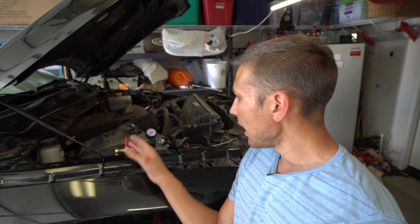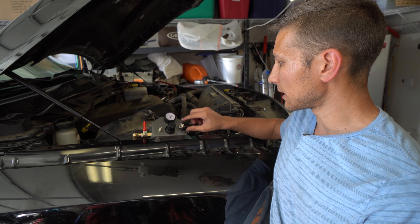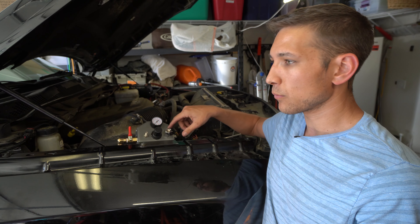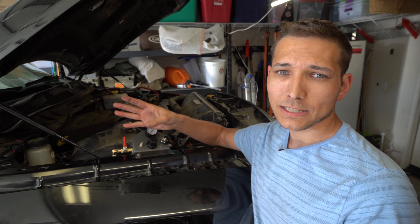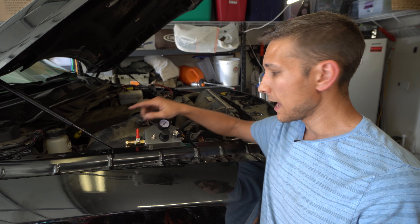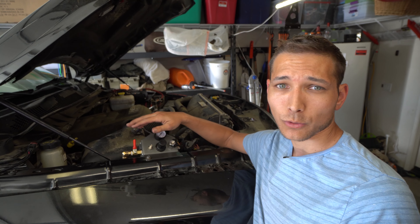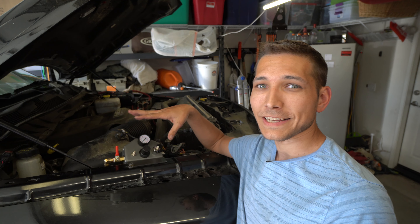I did reach out to UpDown Air to see what they have to say about that, because the kit should have come with the input on the side instead of a plug. Otherwise, installation has gone well. I did add a little on-off valve on the side, because the way the unit works is you have a little valve that you can flip open to air down your tires. But because I'm running an air tank, if I have air in the tank and I open this valve, it would drain air from the tank as well. So I threw the little valve on so I can keep my air tank fully filled up and close it off. When I air down, I'm not letting air out of my tank. Pretty easy to do, and all the push connections are working well — no leaks or anything like that.